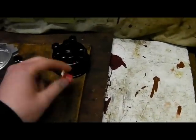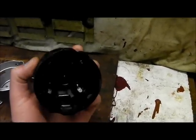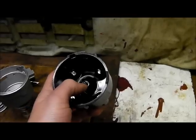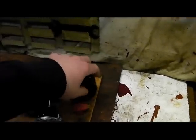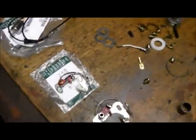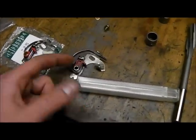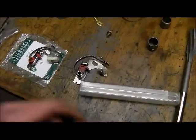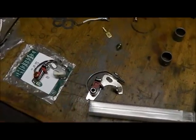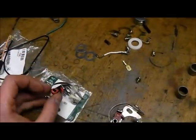Things like the rotor arm are very poor, and on the distributor cap you can see where the rotor arm has been striking all the contacts way too hard. I would say that brush is too hard as well. I've got a genuine set of points because the Chinese ones are too hard and brittle, the springs are too hard, there's too much play between the points and the pin, and the points don't even line up. The genuine ones are much better and the springs are the correct tension.